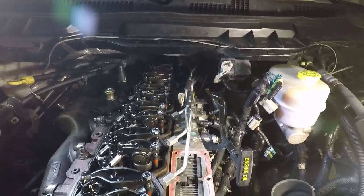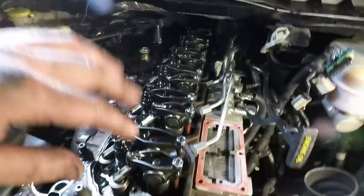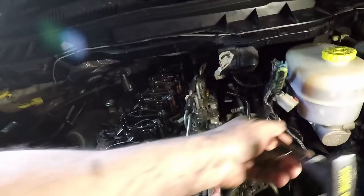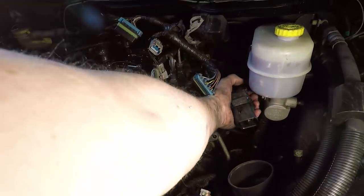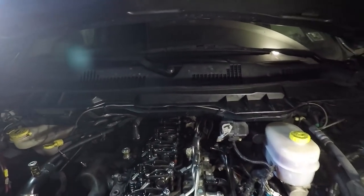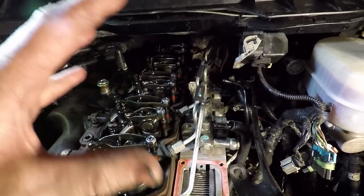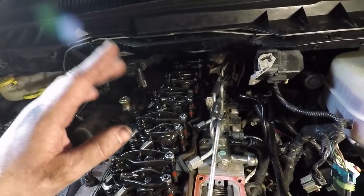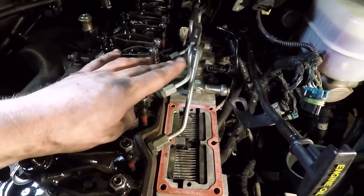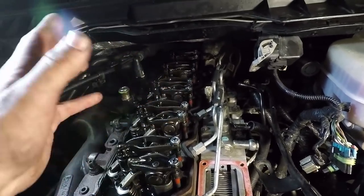The GoPro died — not sure where. We haven't really gotten that far. Got the rocker box off, got that wiring harness for the injectors off. I also undid a lot of the wiring up front — pulled the wiring out for the grid heater just to clean up up front. Undid the dipstick tube, got this major harness undone — just got everything out of the way so we can work. Right now it probably doesn't matter where we start, whether we go after the rockers or the injector lines. I'm going to go after the injection lines just because we have the rockers and all in the way, and just to protect the injectors a little bit.